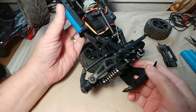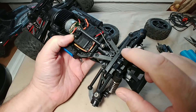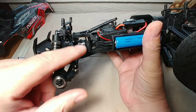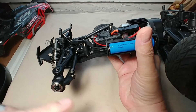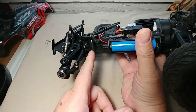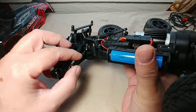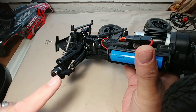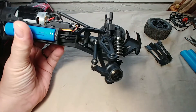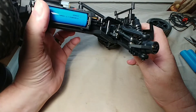I'm going to show you right now what I'm talking about. You can see on this linkage here — we have the servo up on top, a link bar that runs all the way down and gets mounted on another little horn that sticks off of a post with the servo saver right here. It's one of those split servo savers and it's spring loaded on top. You've also got another arm that runs down to another post, and then pressed-on ball links that run down to the hub receivers. The whole thing pivots on that — and to me that's overkill. You have all these links attached to posts and this thing binds up like nobody's business.